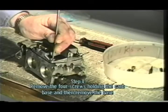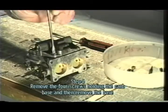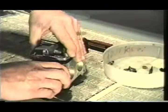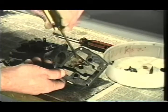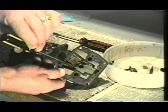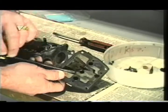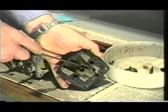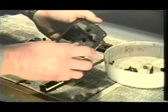You can usually tell when you're pulling the carburetor apart by the smell of it — if it smells like old gas, you can tell you're going to have problems and it'll really need to be cleaned once apart. Pulling our base off, we can see inside this carburetor a lot of varnish deposits in the base. This is caused by gas and oil sitting in this carburetor for long periods of time. This is going to have to soak in our cleaner for quite a while.